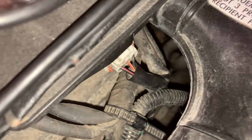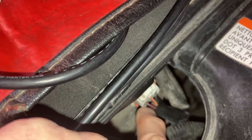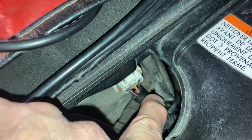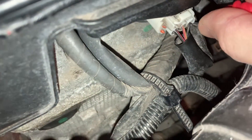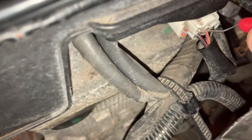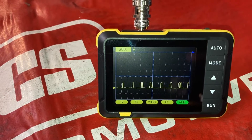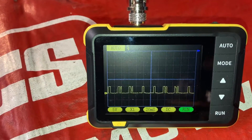To distinguish between those two remaining pins, let's start the car and revisit them. We know the 12-volt supply is on the black and red. Going to the middle wire — the red and yellow — and we've got a signal. It's a bit low so let's adjust the voltage scaling and the trigger so the waveform isn't walking across the screen.